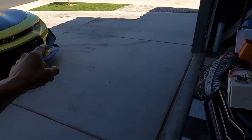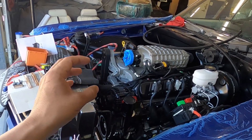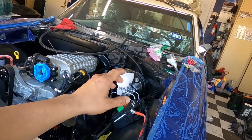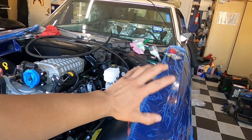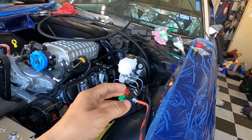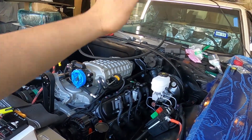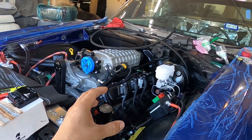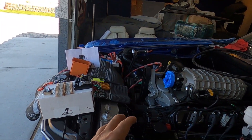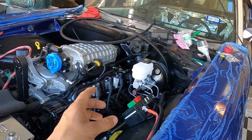What PWM really does — it's something found on new cars. Even the Camaro has it, and it's now used for fans as well. What it does is limit the voltage going to a device. For this Hellcat pump, that's basically running anywhere between about 8 volts all the way up to the full 12-volt circuit. The ECU is saying, 'Hey, we're at idle, we're cruising — no need to dump all this fuel and turn the pump all the way up to its full potential all the time when it's unnecessary.'